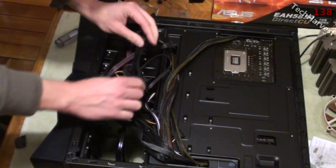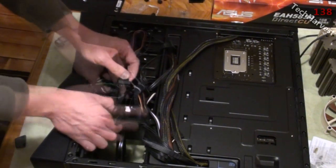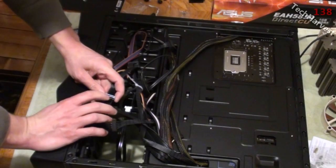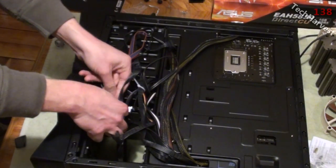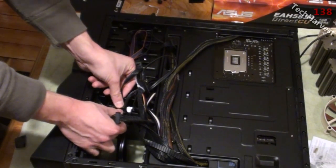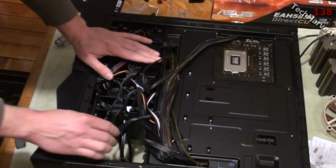I'll maneuver one of these power connectors into place. With a SATA connector, it looks sort of like a small L, so you just have to make sure you've got it lined up correctly with the port — don't force anything. I'll just plug it in right here. There we go: the SATA data cord is connected to the drive and the power supply connector is also plugged in.